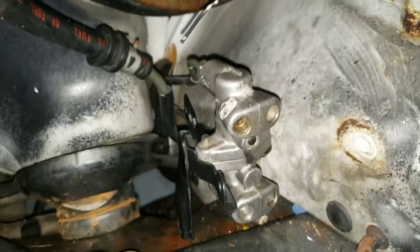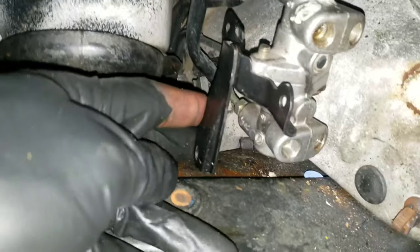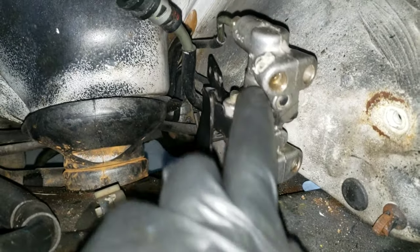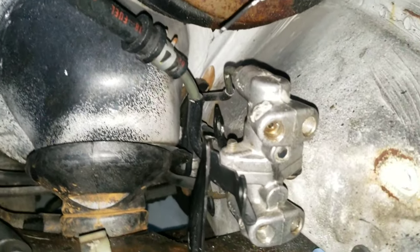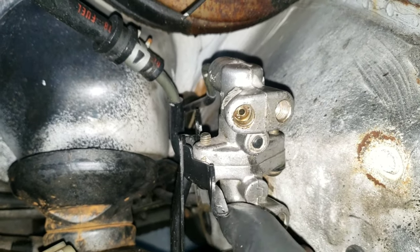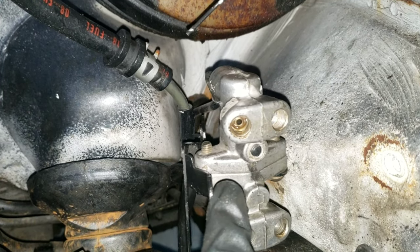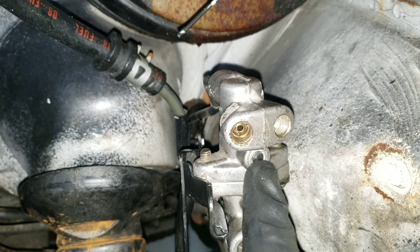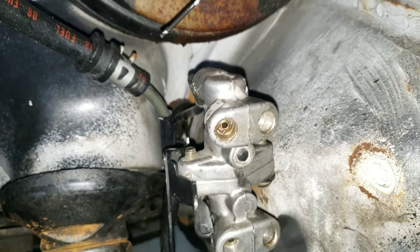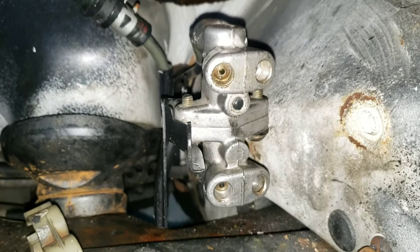proportioning valve here. Okay, now on to the important part, putting the 40-40 prop valve in. So usually it'll come with a bracket. On Integras, this is mounted on the passenger side. So make sure you do not put this in upside down. So this one doesn't have it stamped on there for some reason, but it'll say 40-40 right here. So to know which side is which, of course, you have your two brake lines in the back that say rear on it. But you have your two holes here. If it has the bracket on it, the bracket faces towards the passenger side. And if it doesn't have the bracket, a way to know which is up is this black little rubber piece that goes on top. And the hex torque screws here, they point downwards. So that is how it's put in.